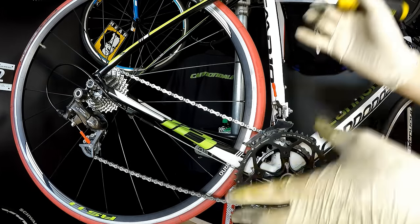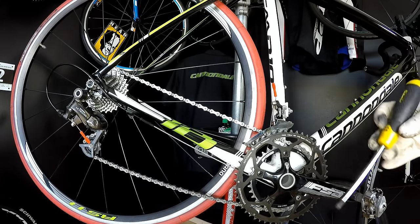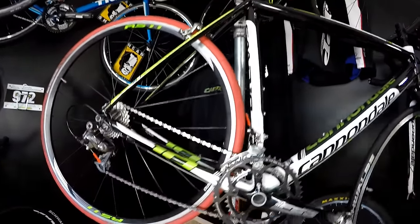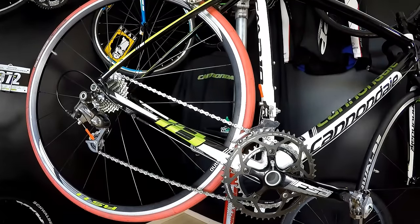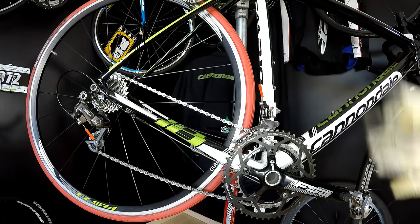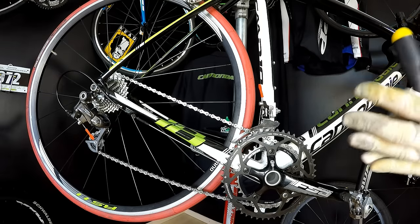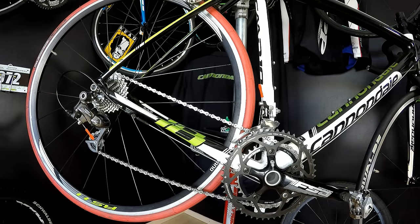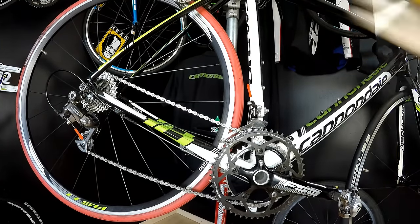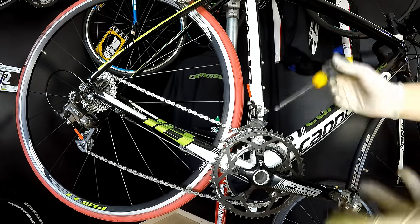We have to rethink when something is going wrong, and of course always when we are changing the gearing ratio on the cassette or on the crankset, we have to check whether the length of the chain is all right. It shouldn't be too long. On some mountain bikes, I would even put it sometimes a bit tight. I'm gonna show you that on the killer just in a second. So we remember about adjusting all here, and then the second thing is the components compatibility and wear.